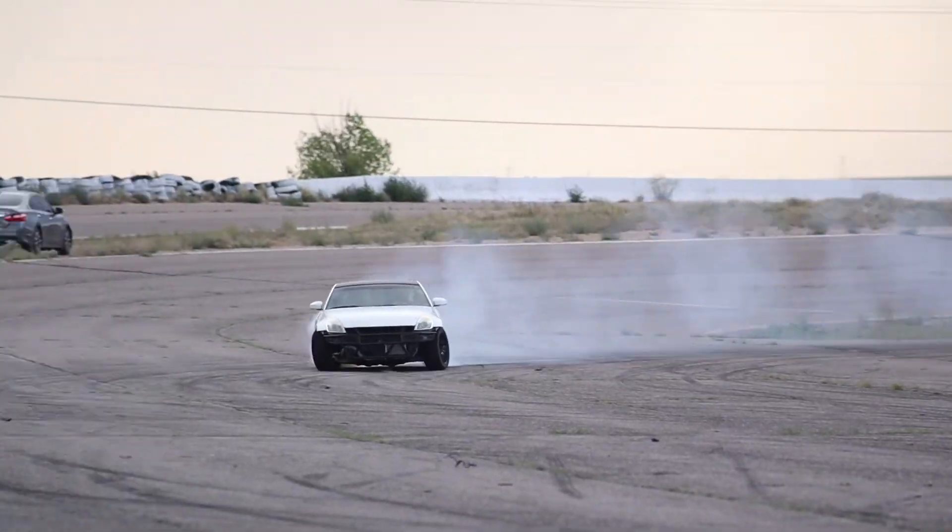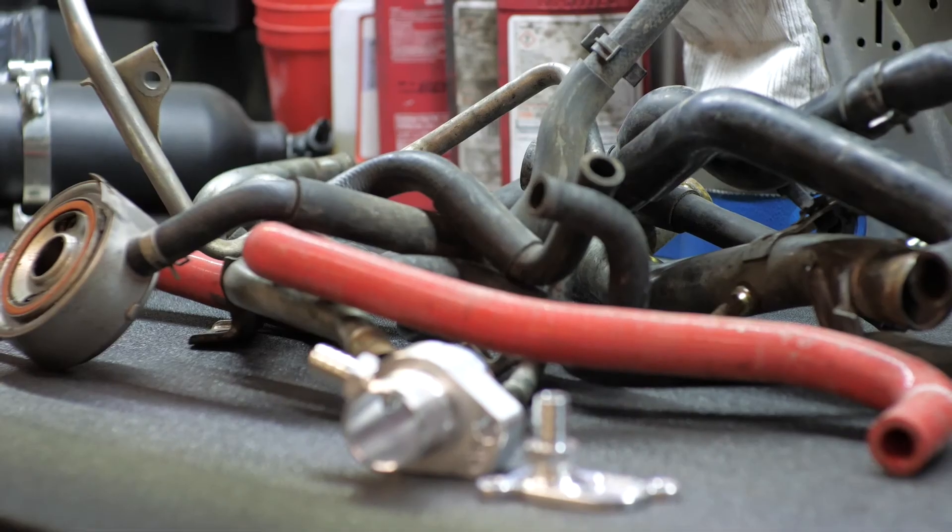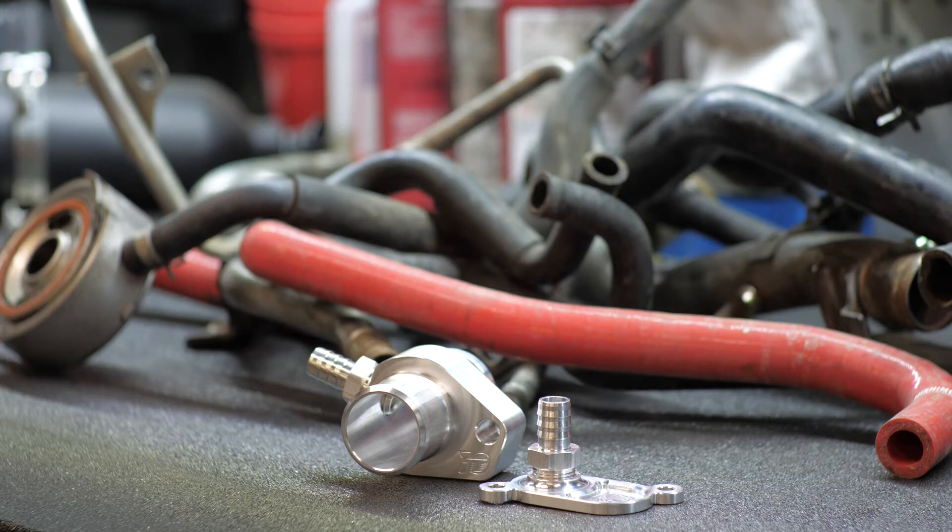We've actually run these same kits on our own cars at events here — Scotty's black Z and my white one. Scotty's does not have a thermostat, mine does. Scotty's does not have AC, mine does. Both cars seem to operate as they did before. I'm not trying to sell this kit claiming it'll drastically increase cooling performance, because the cooling system is more complicated than that — but if you're looking to reduce potential hazards at a track day due to unnecessary hoses, this kit is for you.